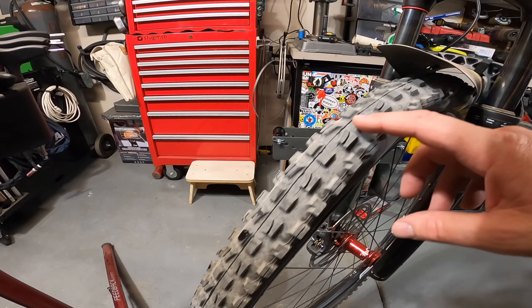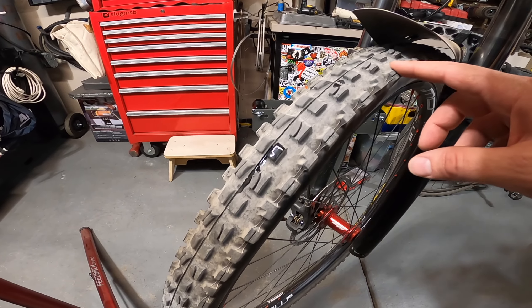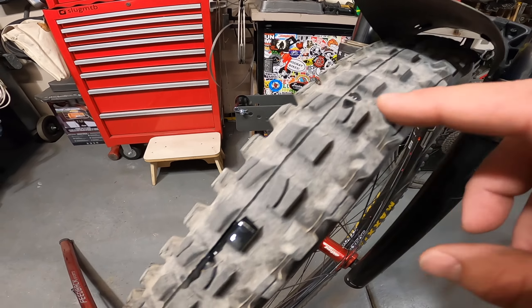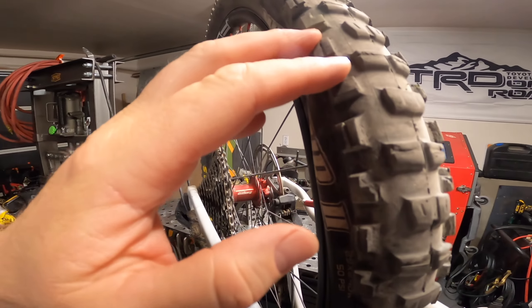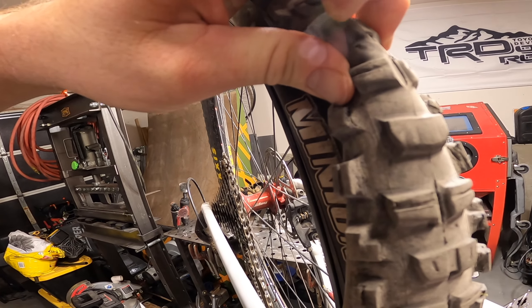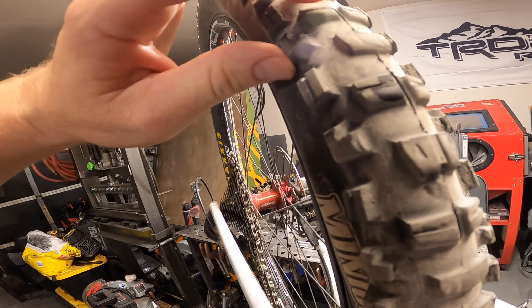Because I've gotten holes or thorns in my tire even in the winter. So what I like to do is go around and remove all of the thorns. You can see where I've got some leaking a little bit of sealant here, front and back. I had flats on both tires — there were a ton of thorns in here and there are still some in the tire. You can go ahead and dismount the tire if you would like.